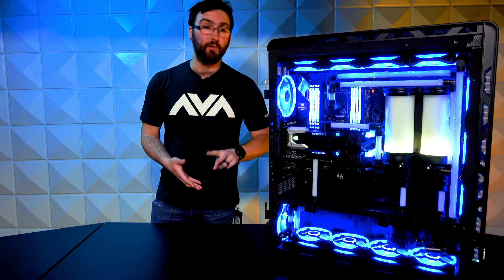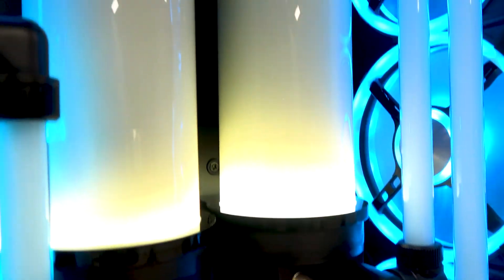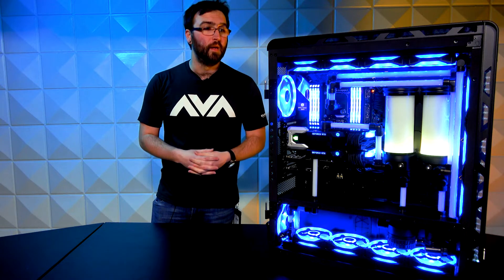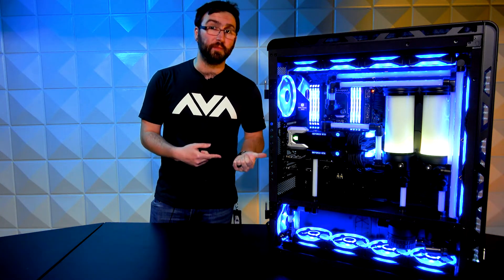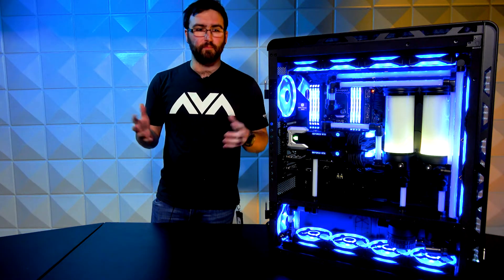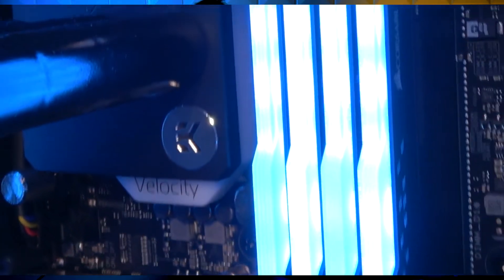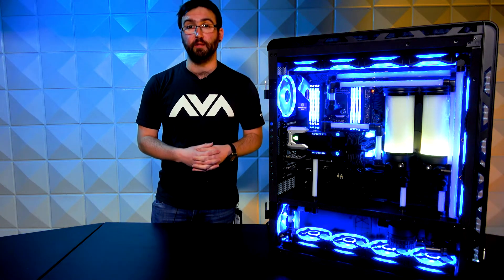The coolant we used is Mayhem's V2. We chose Mayhem's because they have a lower parts-per-million content based on the kind of contaminants you see in a lot of liquid cooling coolants. We actually just serviced one of our Avalanche systems about a month ago that had Mayhem's in it, and a simple rinse with a sponge and paper towels was all it needed — no gumminess in the loop, nothing contaminated as far as particulates. Super easy to clean, so we put it in this loop with confidence knowing this is pretty much how the system will stay long-term.